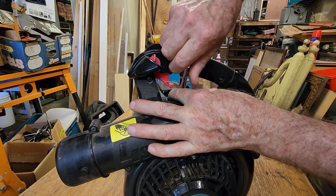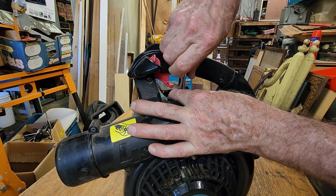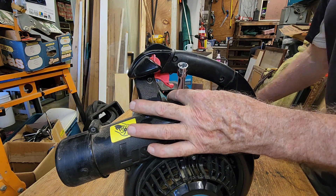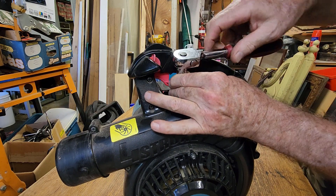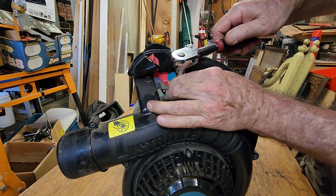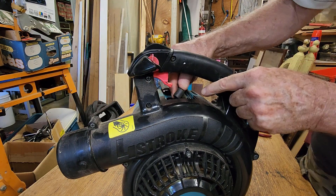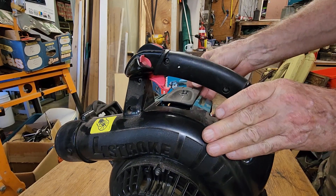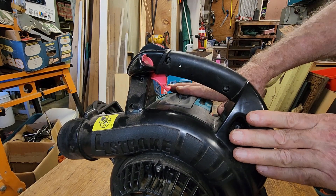You do of course have to make sure that your kill switch is on — many people have tried to repair a small engine with bad spark problems only to realize it was perfectly fine and the switch was just off. We'll put the spark plug back in now. You don't want to over-tighten them because the spark plug screws into the head which is only cast aluminium — the thread can be easily stripped and that causes major headaches. Just nip it up so it's firm, that's all we need. Put the boot back on and slide the cover back into position.